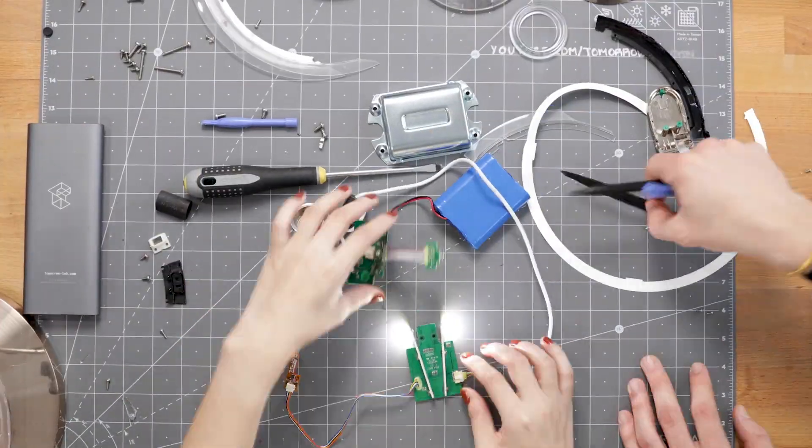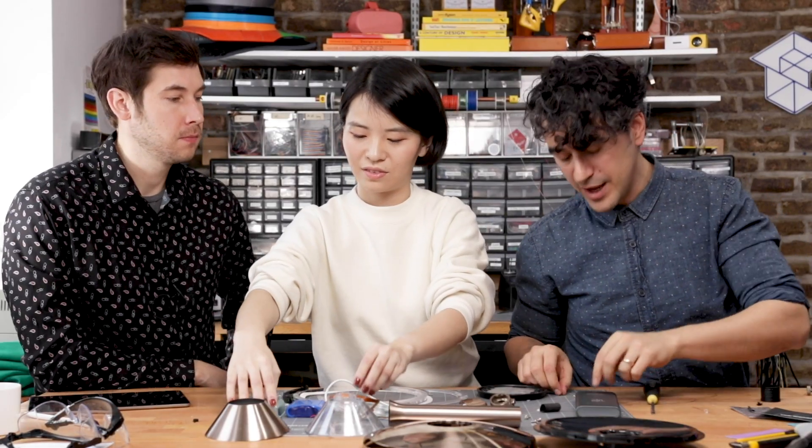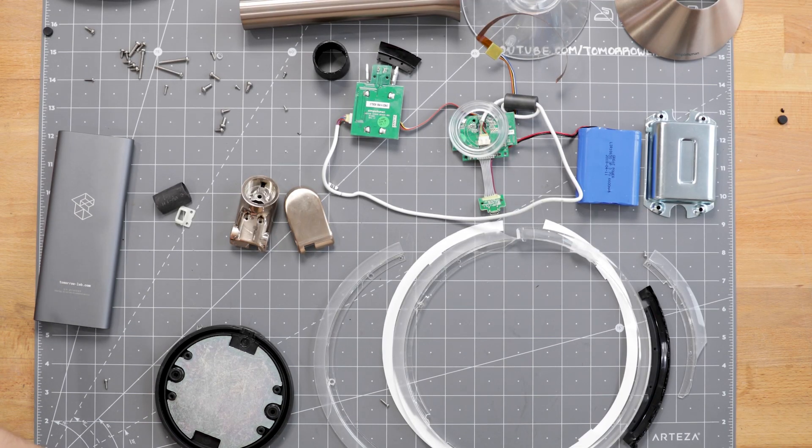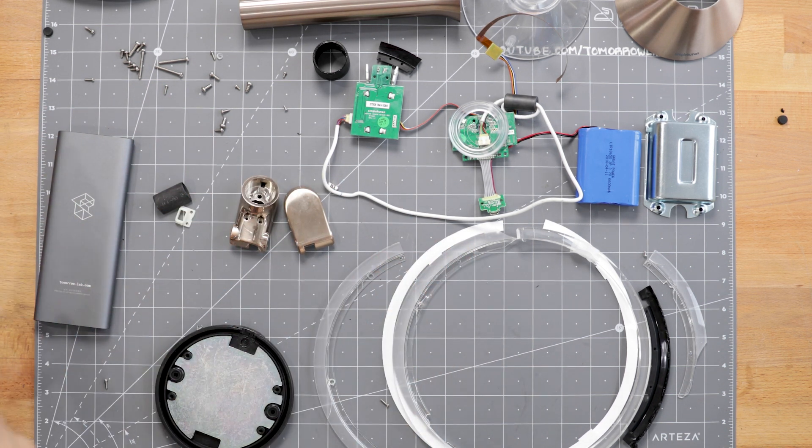So that was a lot of fun. It's really challenging to take something apart when you don't know how it goes together, and really good industrial design sometimes does a very good job of obscuring how things fit. We spotted screws on the bottom and the back of the mirror and took those out. The assembly came apart really easily and then suddenly it got really, really hard — it was like a puzzle box. We spudged and screwdrivered and tried to tear away around the outside and ended up breaking it. When we did break it, we realized it's designed to come off with heat. You warm up the mirror, use some suction cups, pull that off, and it exposed a whole bunch of screws on the inside.